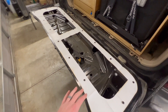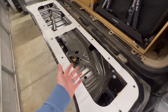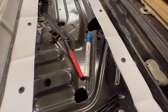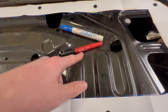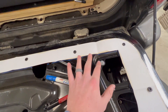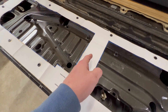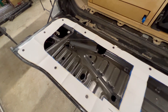I'm going to think long and hard before cutting into my metal tailgate — you can't undo this without buying a new one. I wasn't sure what to use to trace since I only had black sharpies on a dark surface. I ended up using a blue paint marker. I originally tried my Milwaukee Sharpie but it didn't show up well, so I retraced the whole thing. Important note: the template has an orientation — this side up — and you can sanity check because the center support is right there.